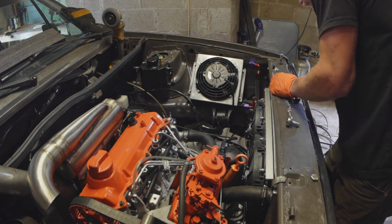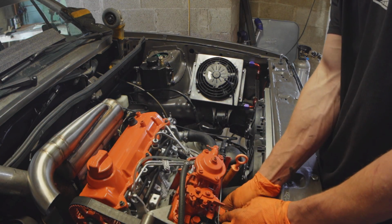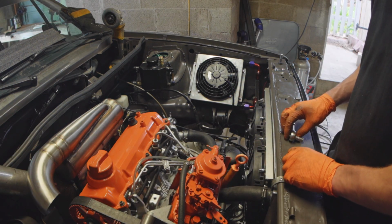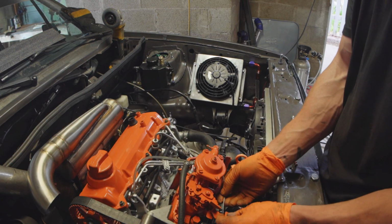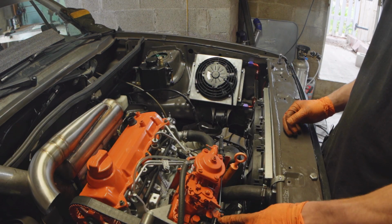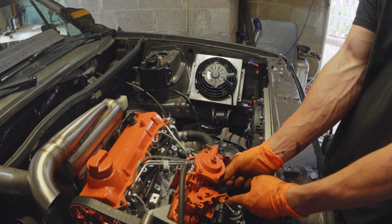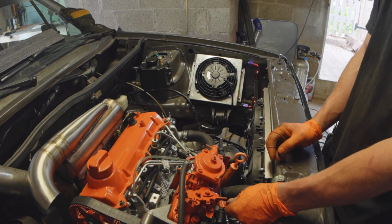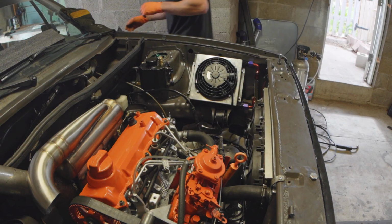because I don't know if that's going to be successful or not. So my next idea is to just clamp what we have, which should be doable. I think we can just clamp what I have in here, because it's basically a cable clamp anyways. All right, and that looks pretty good. So I just turned this plate into a clamp, much like a mountain bike cable, and at full throttle, it's going to be pulling a slightly different way than it is when it's down here, but I don't see that being a problem. Go try it out.